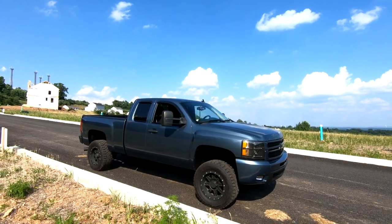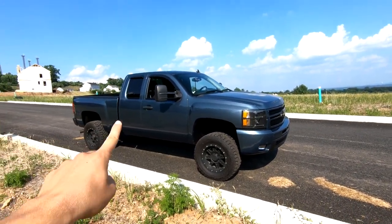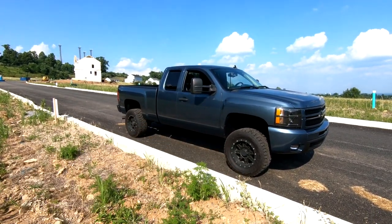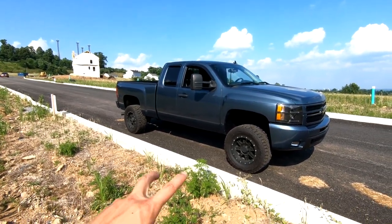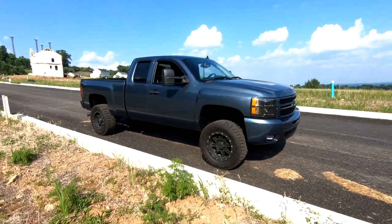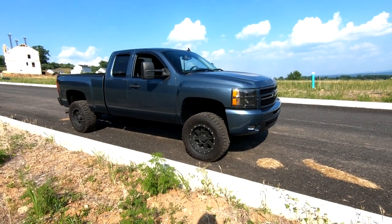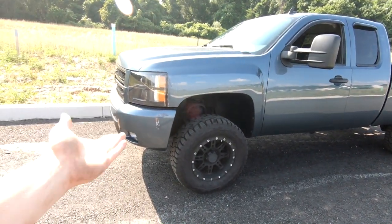It probably would have been the same cost if you'd just bought a bigger lift upfront - a six inch lift, which is the normal thing to do when you want to run 35s. That's the update on my truck with the body lift. I do not recommend it. Go with a bigger suspension lift - you'll want it in the future. Getting a few inches of lift isn't going to clear anything bigger than maybe an inch more than your stock tire size. Especially if you have square wheel wells, go with a suspension lift because you won't fit the bigger tires you want.